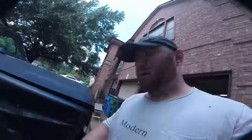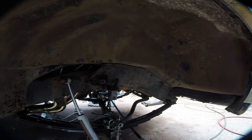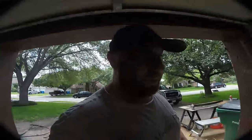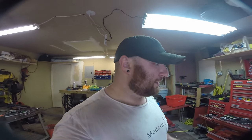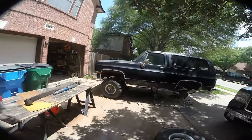Disaster struck — these brake fittings were just so crusty that they just broke. I'm just going to let all the brake fluid run out. I probably have to replace both sets of hard lines. It's not particularly difficult work, but the problem is I don't have a flaring tool and I can't find my tubing bender. So we're going to have to buy a roll of hard line and route our own. That's kind of what our front looks like — you can see this is a dramatic amount of lift.